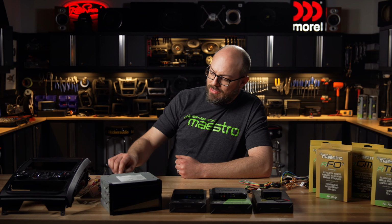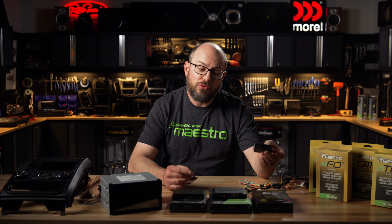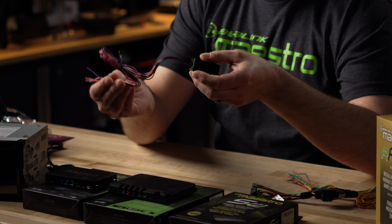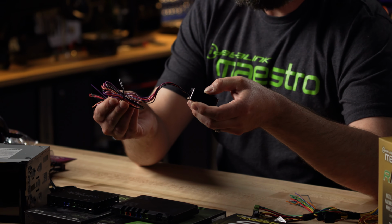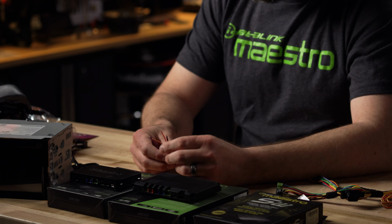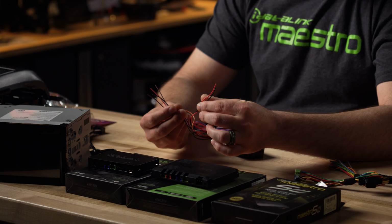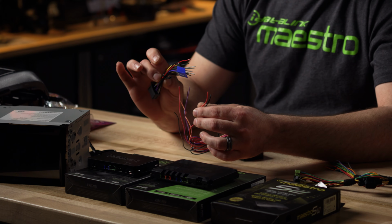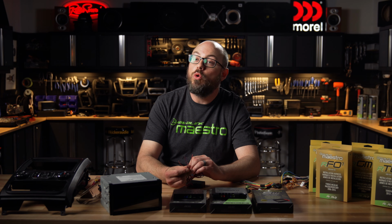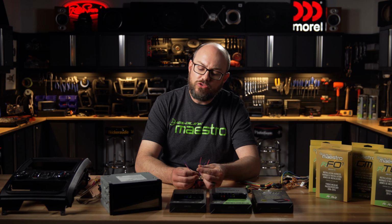One important thing to note is that after you flash the Maestro SW, you will be making connections directly to the vehicle with this interface. So that is one thing you will need to be prepared for. You will have to commonly connect about 2 to 3 wires into the vehicle. There are a few connections that you can make with your radio harness on the bench. You can go ahead and connect the red and black power wires from the Maestro interface in with your radio harness when you're making connections to your vehicle specific harness. Then that way when you get to the vehicle, you'll only have these extra steering wheel wires to actually connect. And as I said, commonly, it could be 1 wire, could be 2, could be 3. It's usually no more than that.